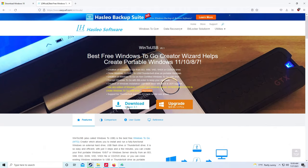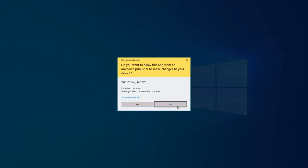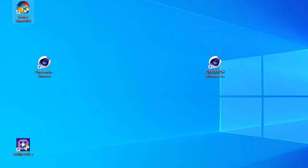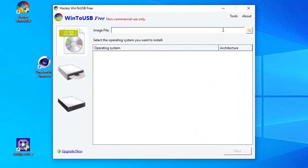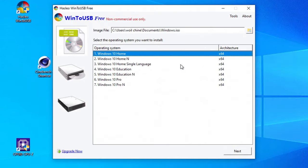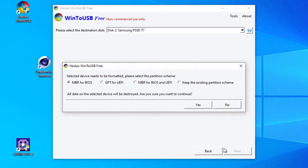While Windows 10 is downloading, go ahead and install the Win to USB tool. Go to the easyuefi.com link in the description and download the Win to USB free .exe tool. Hit save file, run it, and it'll go through all the steps to install the Win to USB free tool. After it comes up saying to burn the ISO file to a DVD, just hit finish. Then open the Hasleo Win to USB tool, select the image file from Documents, select the Windows image file, hit open. For this to be free, you have to use Windows 10 Home. Select Windows 10, hit next, then from the dropdown select our Samsung T7, format it in GPT for UEFI, and hit yes.